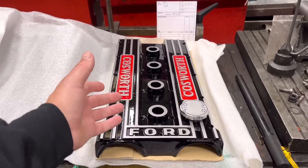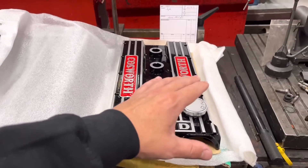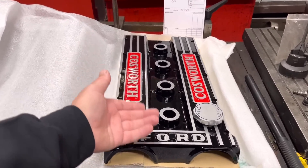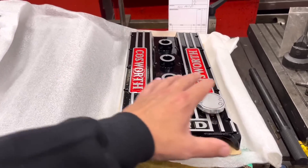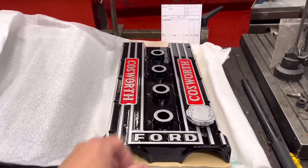It's going to be a lovely build - still hydraulic setup on the cams, trick cams, but it's the hydraulic setup. So it's going to be used predominantly for road use. And this is a proper period Cosworth cover that's going to look wonderful in a Mark I Escort. Absolutely beautiful, can't wait to get that on.